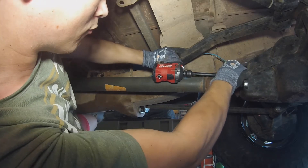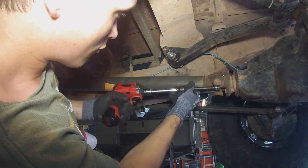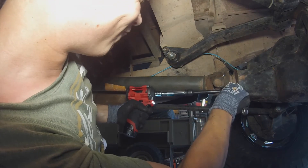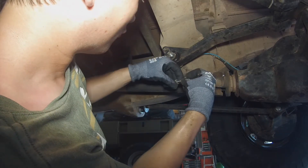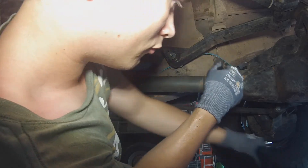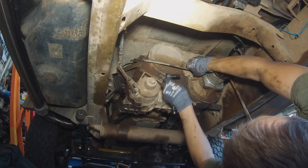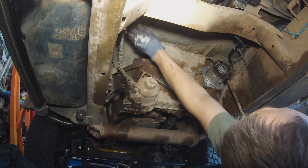I like using this 9/16th prop shaft nut tool, and I have found undoing the diff flange first makes the nuts at the handbrake easier to get to because you can hold the shaft out of the way with one hand. The handbrake lever assembly can be quite fiddly to remove, although you can access this through the hatch underneath the driver's seat.